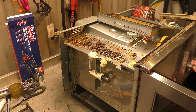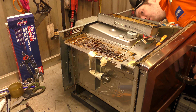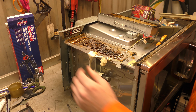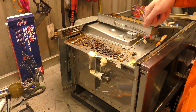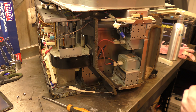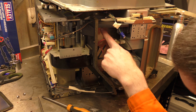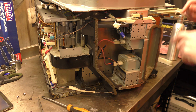So where does the fan live? Perhaps it is all one fan — one for cooling the magnetron. Yeah, I can only see one fan. So it must split the airflow over the magnetron and through the exhaust. I'm gonna give this a clean now as well — a bit of a scrape and a hoover, and we'll do the inside too. As I found out, this fan blows across the two magnetrons, and also blows up through the grill in there, and that goes into the microwave cabinet and back out through this exhaust vent, which is now scraped and clean.